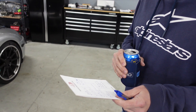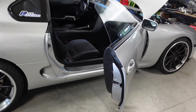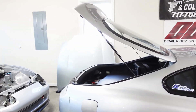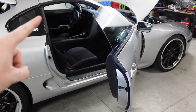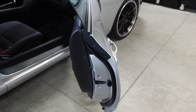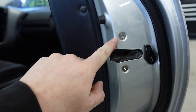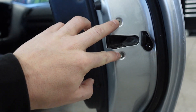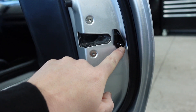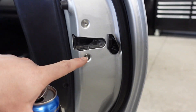Sean's here — he helped me and made notes like my secretary. I talked to Seth over at Dress Up Bolts and he said to put a video together with the bolt lengths and thread pitches. Color doesn't matter, that's up to you. Starting with the inside of the door — note that these quantities are for both driver's and passenger side. For the bolts here, here, and here: M6 by 1.0 by 20 millimeter, quantity of four, countersunk head. Then you'll need M6 by 1.0 by 10 millimeter, quantity of two.